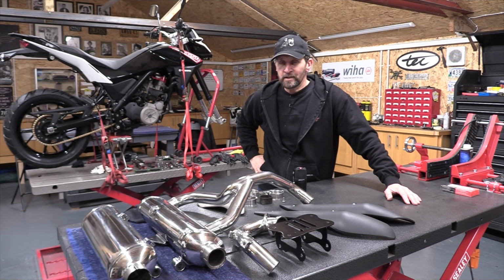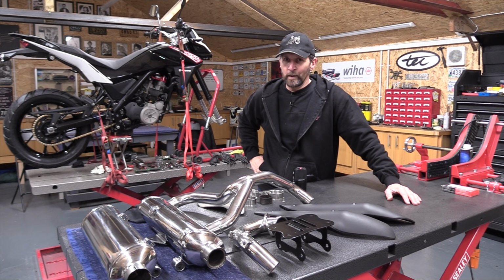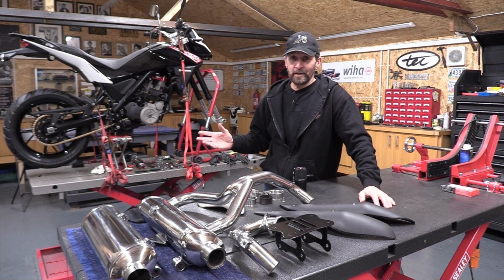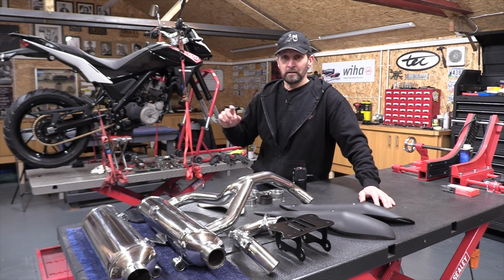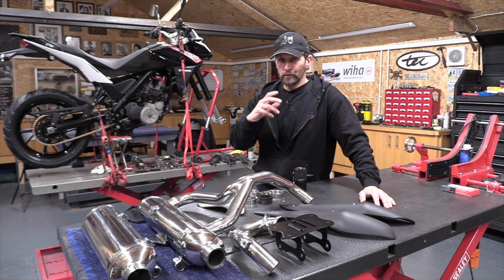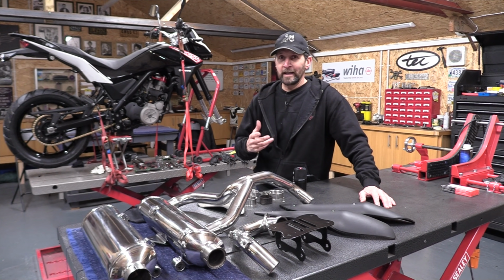Now, I want to answer one obvious, inevitable question. Why didn't I torque anything up today? That's because I torque everything up at the end. Some fasteners today are staying put, but others have got to come back out again. When I change that shock absorber, I've got to drop all the short link off and then put a new one in and do it all up.